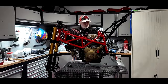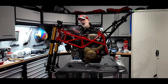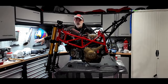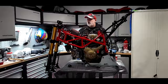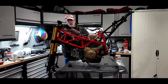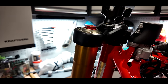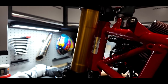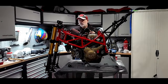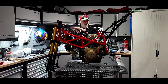It's been about a week and a half since I last did anything to this motorcycle — I've been in Spain racing around tracks with Michelin. But it's time to get back to the Hypermotard and the swinging arm, which I've been absolutely dreading. I've finished fitting all the forks now and I've loosened off the yokes a little bit — even though I did them up to the recommended torque, I think the tapered bearings pull a bit too tight compared to the standard bearings.